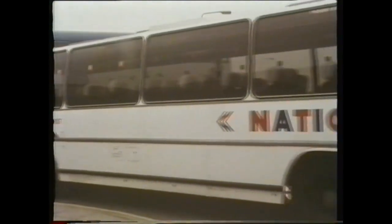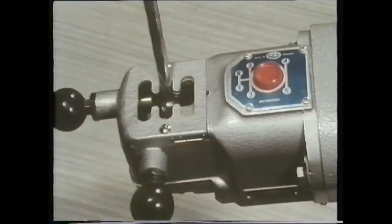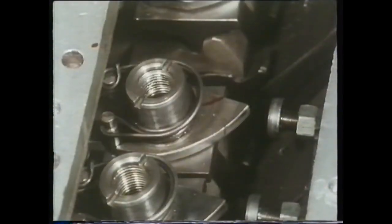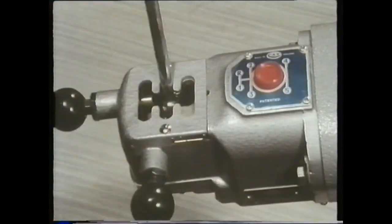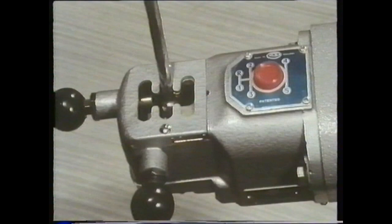As an example, assume that a vehicle, on its return to the depot, is reported to have a condition of no drive in second gear. The first check should be made here. Toggle the gearbox brake band by engaging the gear approximately 12 times. Pause briefly between these applications, or the correct adjustment will not take place. If the problem is simply one of adjustment, this toggling exercise may correct the no drive or slip condition.